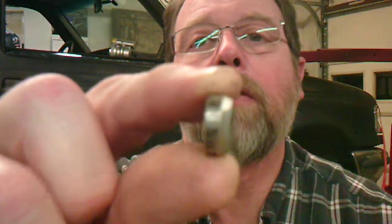against the top of the tunnel, and at the same time I could get the input shaft right to the point where it was hitting the fingers right at the top. I didn't need much, but I just couldn't get it because I was bottomed out. So the first thing I did was I took a grinder to the input shaft. You can't see this very well, but the front part I took off about 60-80 thousandths and then redid the taper on it, as you maybe kind of see there.